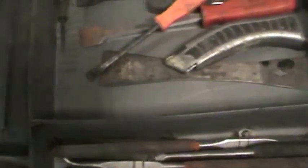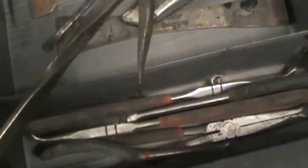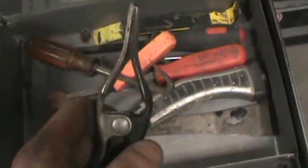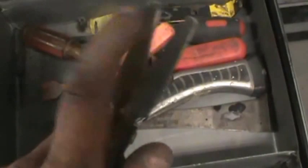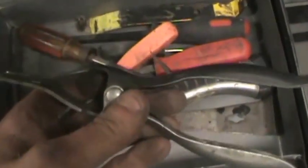Picks — I make a lot of my own tools. This was a screwdriver; I got bored and twisted it. I make all of my picks. Another Harbor Freight beauty is this little bugger — when I was doing a lot of engine swaps, this was indispensable. This side has got a groove or serration — it's milled and it actually grabs a steel line, and this pops the plastic tubing off. I love that thing.